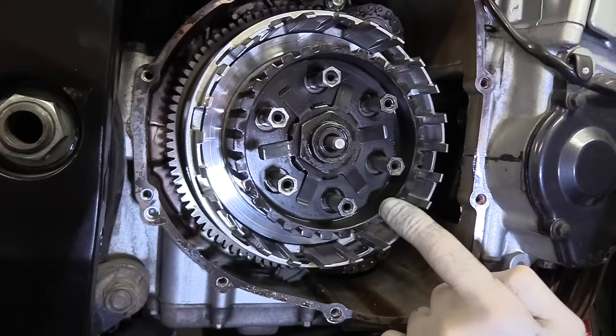This is aluminium, so you're always going to get this polishing. But the thing again to do is run your finger along each one, inside and outside, and just make sure that none of them have got rough burrs on and that they're not too grooved. You're looking along that edge all the way along, like a castellated groove in there. Now, they all feel a little bit textured on this, so this is clearly the original clutch basket, but it's not too bad at all.